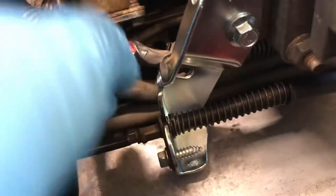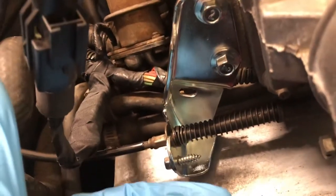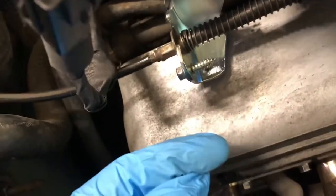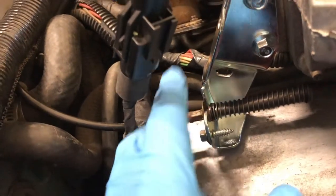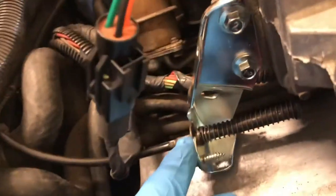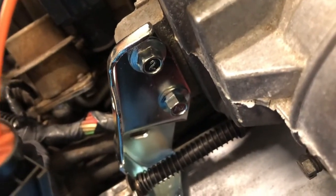I also did this bracket - mounted right here. This bracket originally extended further and had a place for the cruise control cable, but I wasn't using the cruise control, so I cut off that part of the bracket and cleaned it up. I needed to do the treatment to keep that exposed fresh metal from rusting, so I just did the whole thing and went through the process. As you can see it looks like a brand new piece - very shiny, almost chrome plated. It's not polished, but it is definitely very shiny.